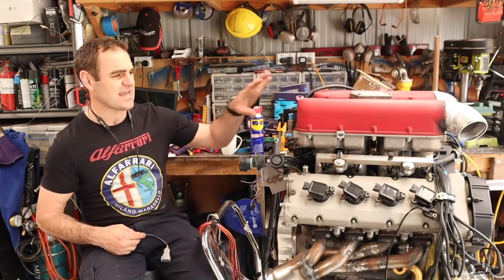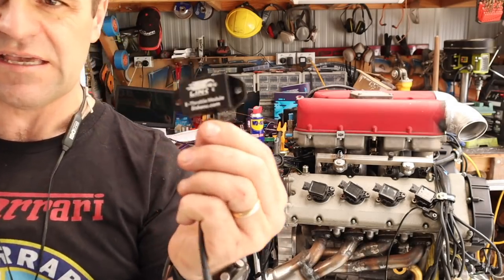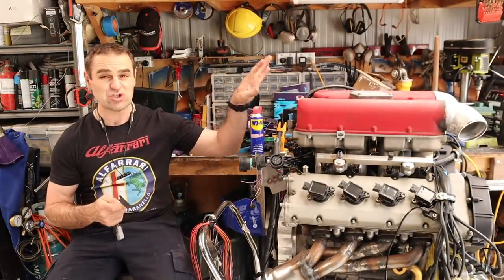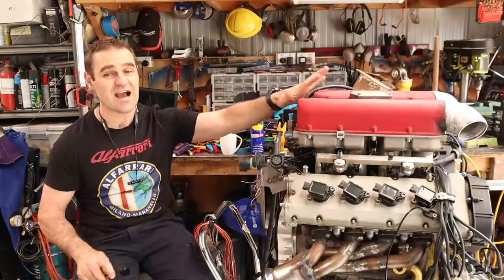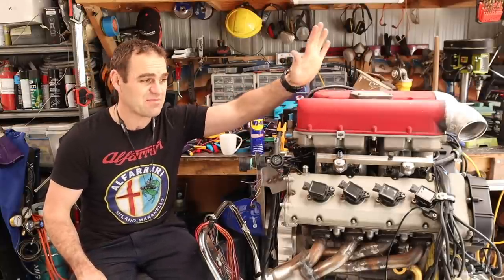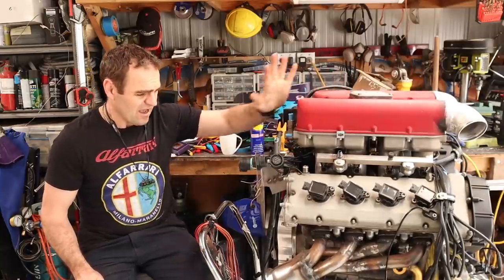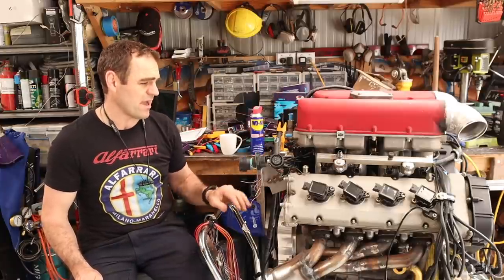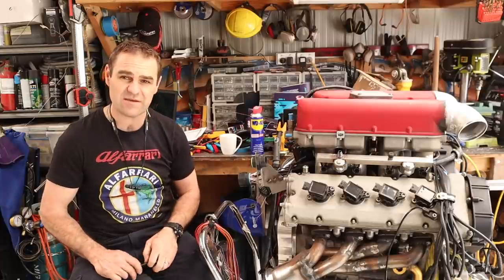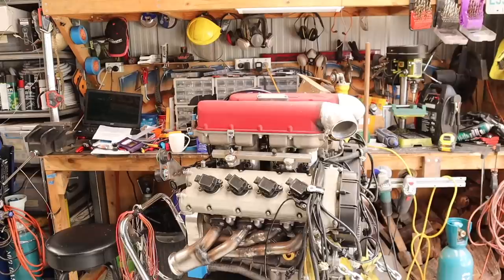It makes this car extra complicated with a couple of things. I had to run one of these Link modules. This is an e-throttle module. Basically, this is so that I can run the two throttle bodies, because a lot of aftermarket ECUs can't necessarily run two separate throttle bodies. You need an ECU capable of that. So I've wired that up now, and I am quite happy with this. Now I'm going to go through and see if we can strip out the unused wires, and then we can get onto another thing that I still need to physically do to the engine.